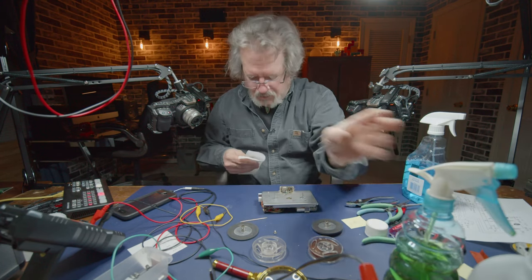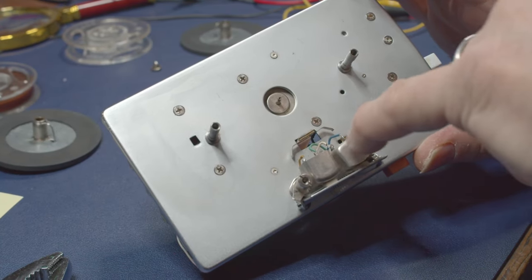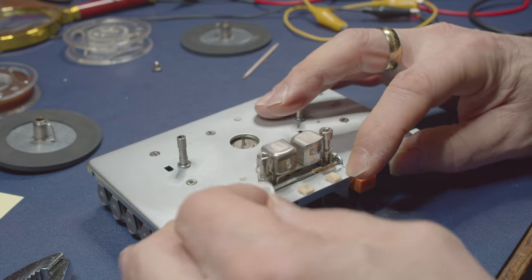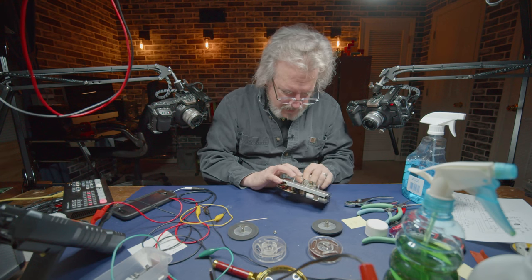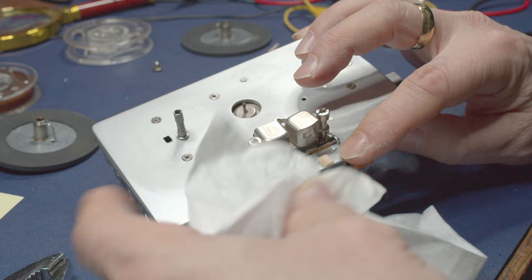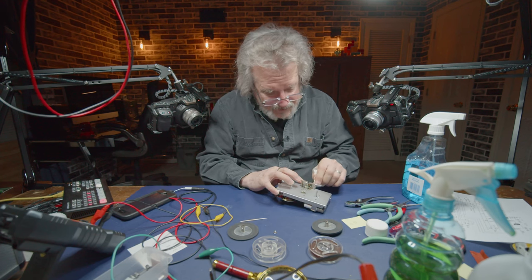Down inside the motor it's kind of dusty - I'll use this tech wipe. There's also dust behind the tape head wires and behind the little pressure pad tape door. Be careful cleaning out behind the tape door because those little felt pads have been on there for over 60 years and you don't want to disturb them. In a lot of cases those felt pads are just shot, so you'd change them out, but these are in good shape and still stick - if it ain't broke, don't fix it.